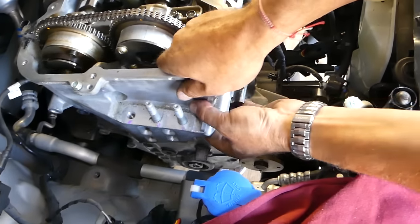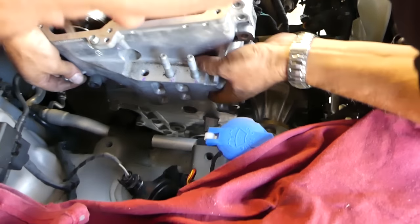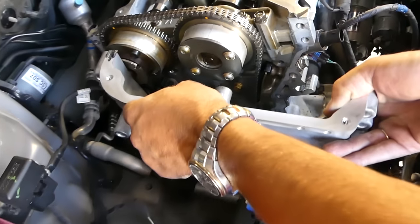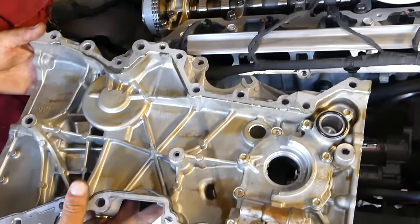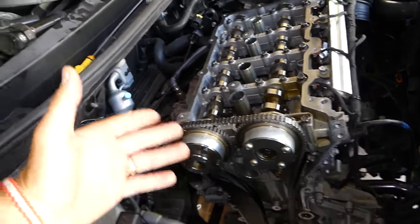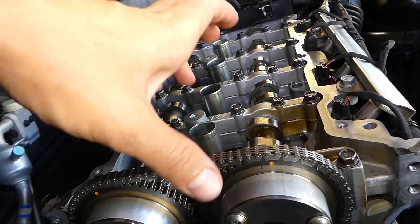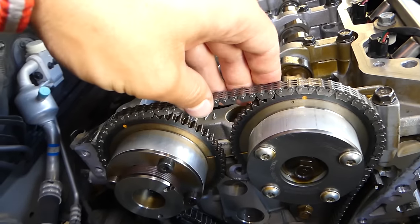Okay, let's see how we're going to pull it up or down — eventually it comes out. After we remove the timing cover, this is the timing chain guys — we got to it. You need to bring the engine to TDC — Top Dead Center — point. TDC is when cylinder number one is at the position where it cannot go more up; it's between going up and going down. That's top dead center. We have a detailed video on how to find it if you need help. At TDC those pockets will be pointing towards each other.